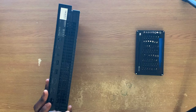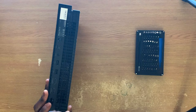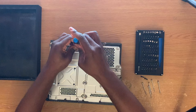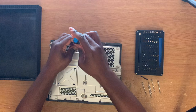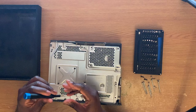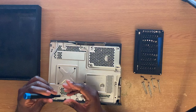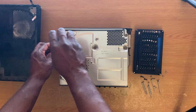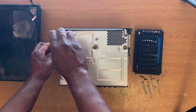We can talk about disassembly. Whichever method you're using, you're going to need to take the console apart to get at the hard drive and its connector. Since a channel called XFIX already has some very helpful disassembly guides — the same ones I used — I'll link those in the description. XFIX also has guides on how to format a new drive and prepare it for use in an Xbox One. If the drive you're using came from an Xbox One, you shouldn't need to partition or format anything. In fact, as long as you haven't tried to restore the console to factory settings and the dodgy data cable hasn't corrupted the files, all your downloads, saved games, and profiles should still be there. If your drive is super corrupt or you've tried to reset to factory settings, you may need to do an offline system update after completing this and start fresh. I've included a link on how to do that in the description too.